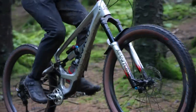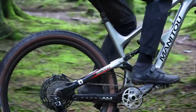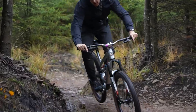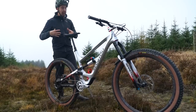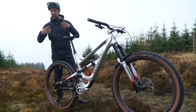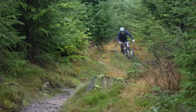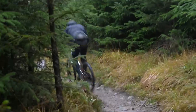If you think when you're hammering power down through a bike, you know, if you're a heavy person, you're putting the power down, there's going to be flex. That's just part of what bikes do. And as a result, some hubs can be guilty of basically disintegrating the bearings because of that. So some hub manufacturers overbuild the hubs to cater for that, which you get a nice stiff hub, but then the bearings will go. What they do on here, they enable the flex to actually engage more pawls. So the more power you put through it, the stronger that engagement gets.